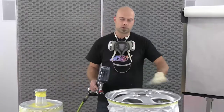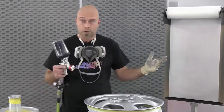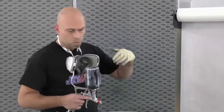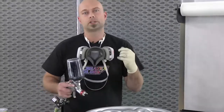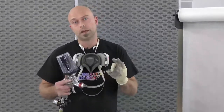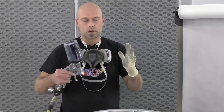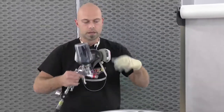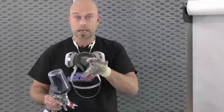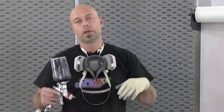Hey guys we are back. It's been about an hour. Our wheels are nice and dry — everything is good to go. We gave them a quick tack before spraying again to make sure there's no surface contamination, and now we are ready to spray our tint coat of our Candy 2O Black. Candy is a little more difficult to spray than average base coat because it is transparent. It's very critical that you have your mix ratios dialed in and you're comfortable with your distance from the panel and how your overlap is. With candies you want 75% overlap — you are almost right on top of your previous pass every time. You don't want a big space because that's going to give you stripes, and if you start with a stripe or any blotch in the candy it's going to look that way throughout the entire project. You can't make that go away.